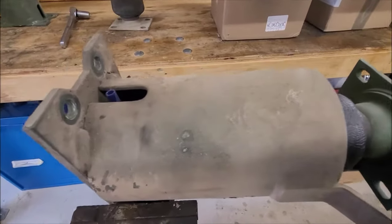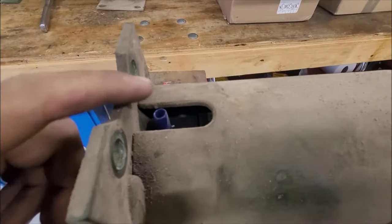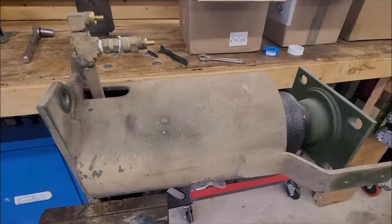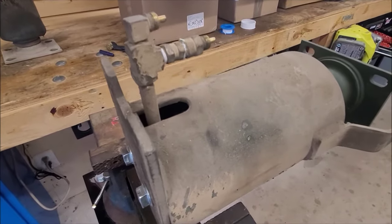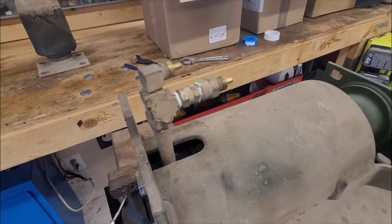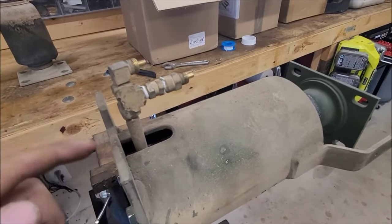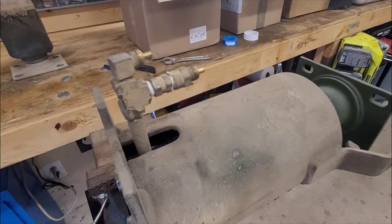I got it switched over. The only thing you've got to pay attention to is this little rubber plug — I'm going to pull that out when I make my way over there, but make sure it's coming through here. What I just did was I decided it would be dumb to try to line this up and thread it after I put it in the truck. I also figured I would check and put a little drop of lubrication — there's a little check valve in here. If you take it apart, make sure you don't put it back together the wrong way. These are actually supposed to face up, but I removed this so it wasn't in the way of the nuts and bolts. I'm going to leave it like this and then do the half turn on it once I get it in there.